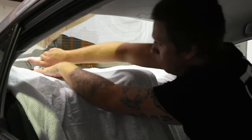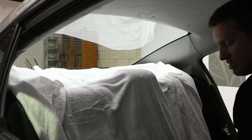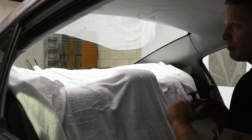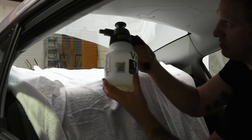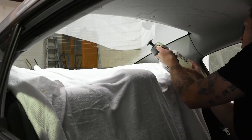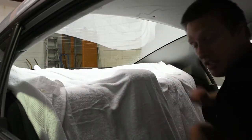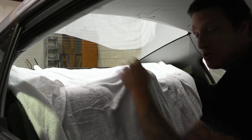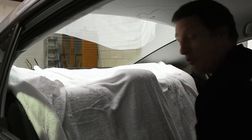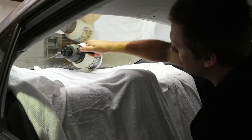The other option is the side swiper or a rear screen tool — we can make a swipe across there and it's all clean. Some people prefer a lint-free towel to wipe the excess off the edges, or you can flush the window. With a lot of the newer cars just be careful because there is a lot of technology down underneath the parcel shelf. On Range Rovers and similar cars there are computers, so if you put too much water down there it can make its way to the computer — not a fun conversation to have with the owner of a hundred-thousand-dollar car.